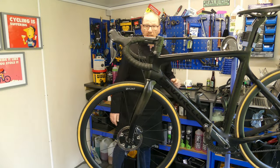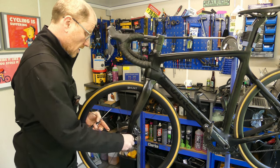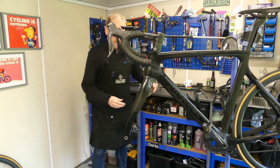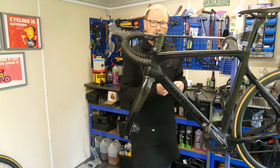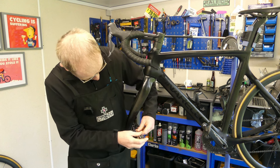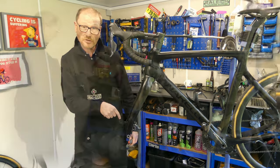To get to the pistons we need to get a few things out of the way: the wheel and the brake pads. Remove the wheel, then the pads — there's a little retaining pin on the back. Top tip: get yourself one of these little workshop magnets, great for storing all your little nuts and bolts — only about £7 at most workshop suppliers. Pads out of the way.